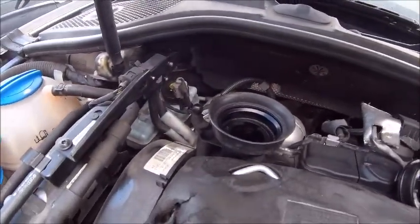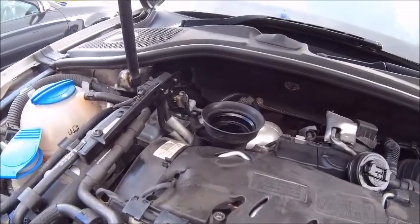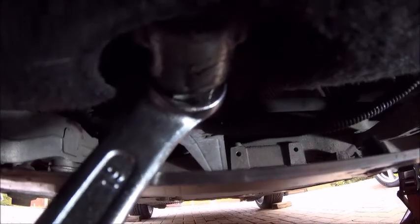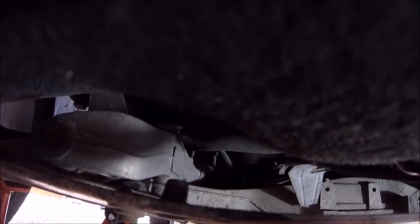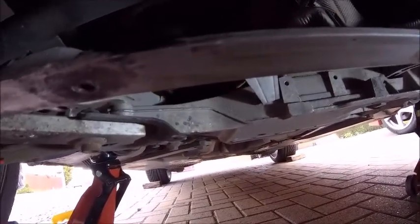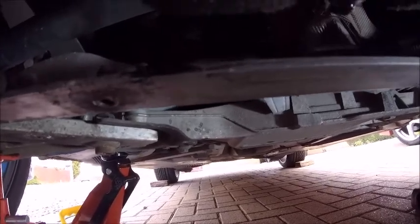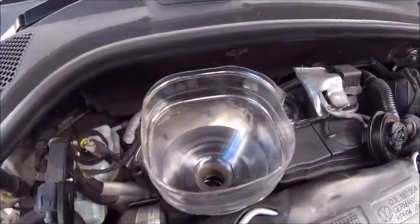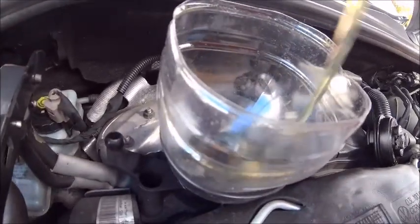There's my oil fill. Let's get my special funnel and slam some oil in it. Oh, sump plug first — don't forget. New sump plug. Okay, as I've mentioned before, with sump plugs it is an alloy sump, so you don't want to go mad — you don't need to be welding these together. All you need is a little bit of tightening up. And remember, this one's a new one, so the crush washer's going to be a little bit soft at first — just get it to the point where, pretty much it's at about five to eight newton metres. That's all you need. You don't need to hang off it, you just need to get it snug. Some people have laughed at my special funnel — it's one of the best ones you'll ever get. Just an old pot bottle. Does the job perfectly. Plenty to aim at, easy pouring, no drama. She's had about three and a half litres now.